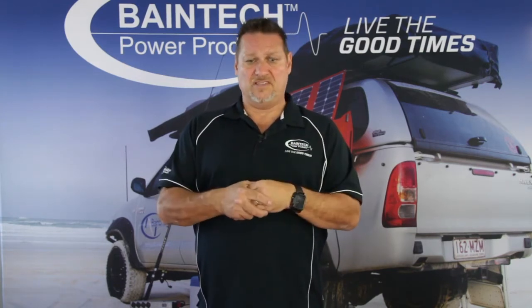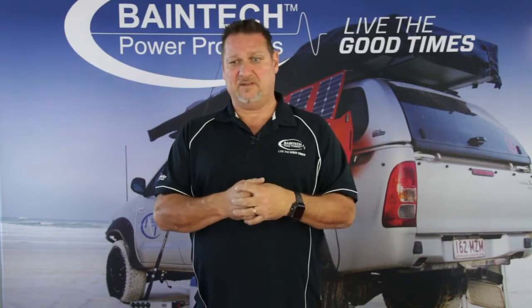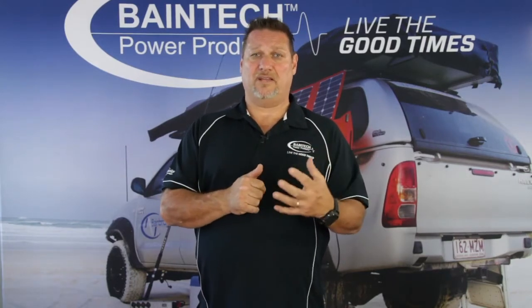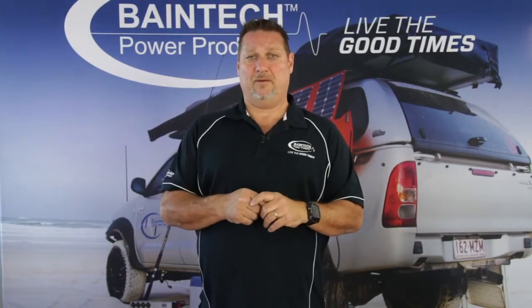I've seen some videos where guys are going, look, this thing's putting 80 amps into my battery, it's going to be charged up in an hour or whatever. That's great, but you can overcharge a lithium battery too quickly as well. So you're going to fall back into that habit of the battery not lasting as long. And as we all know, lithium batteries are more expensive. In the long run, they're definitely cheaper, but there's no point burning them out prematurely.